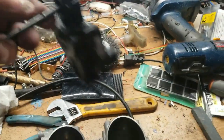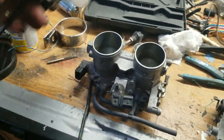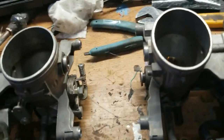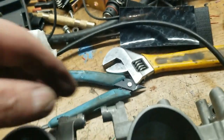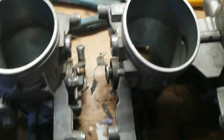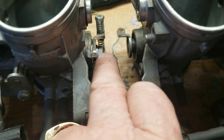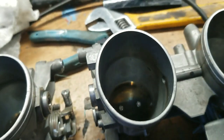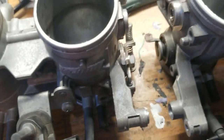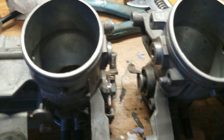Now they're separated. I've got this which is going to just go in the bin. I've got two sets now. I need to put a 13mm spacer here and here and somehow figure out how to bridge this gap between this one and this one. I could probably fabricate something that connects those two, and on the injectors I'm going to have to splice a 13mm pipe between the two.